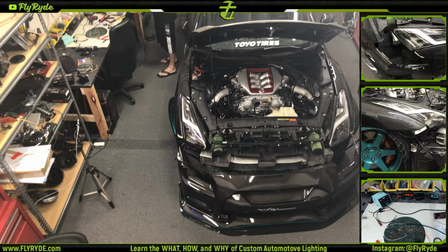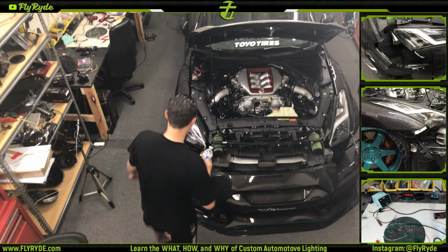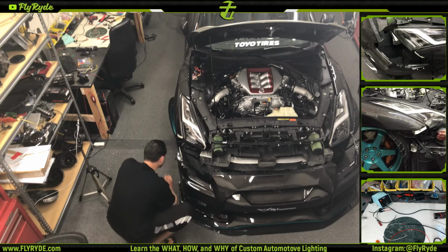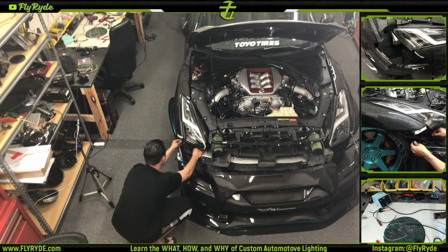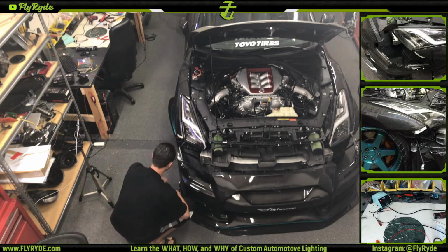That's coming from the strobe unit. Oh, got it. I'm glad I didn't solder that one on yet. So what I'm gonna do is grab the wire right here, and I'm gonna tap that. The white wire is gonna come from here, and then I will grab the running light wire from here. So they're gonna kind of V out a little bit. Okay, that works.